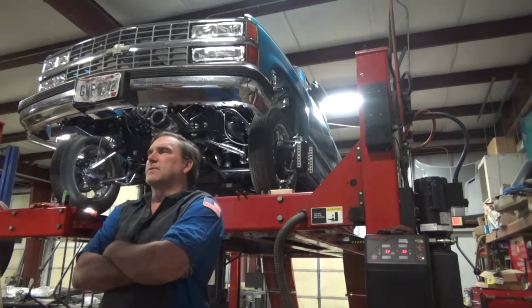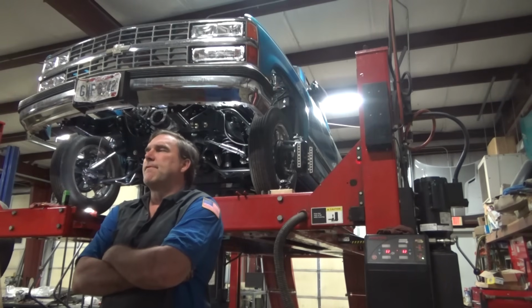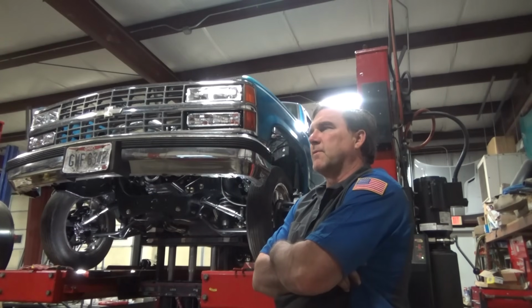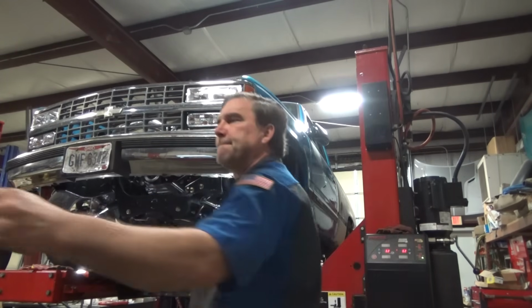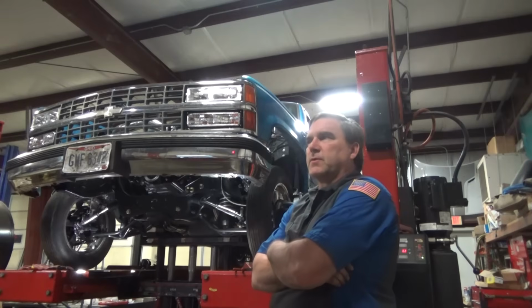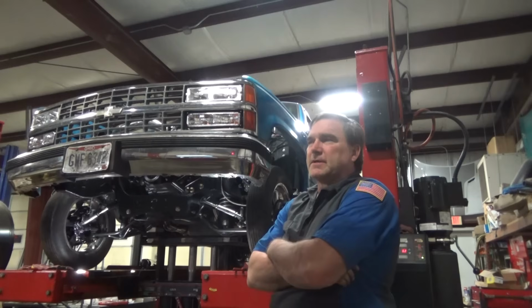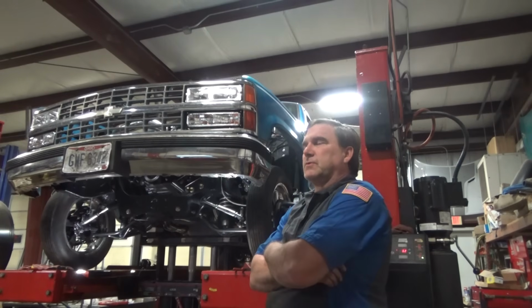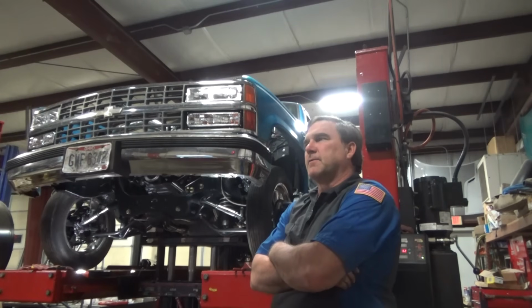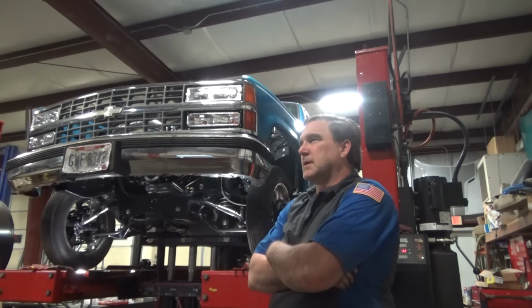I wonder if this has a bent knuckle. I've been up and down this thing too many times. I need to walk away from it. I think I'm going to get some 3-degree shims for the rear axle to reduce my pinion. That will at least make it drivable, and so they can do some tuning and get some things moving while I kind of debate on what we want to do. Might want to get some new knuckles for it.